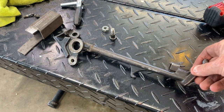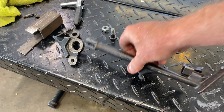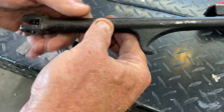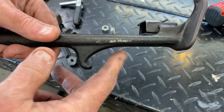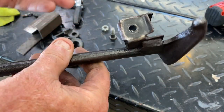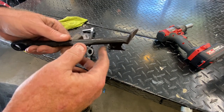It's easier to just take the whole bracket off. I got it out — that broken rubber part was a mother, but I got it out, no problem. Now we're going to make a decision on where to cut this so we can extend it. The best place would be where it's thicker, but then we have to move the purchase for the bottom of the spring and I don't want to do that. So I think the only choice is about right here. I'm going to go ahead and chop this with the zip saw over in the vise and take it from there.